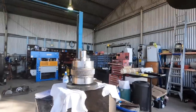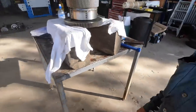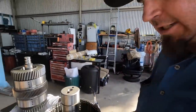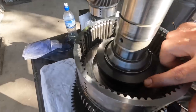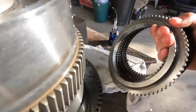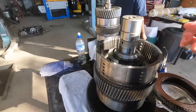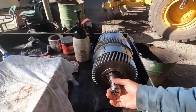Well, good afternoon and g'day there, everyone. We've just been putting our clutch packs together, and I've got my little platform here. I've got my piston in, and it's got a spring return there, so the circlips, we did that in the press. Then we'll put our clutch plates in, and we put the top on, and then I'll line it up. I'll show you in a sec how we line it up. And these are sort of a completed one here with it all put back together.